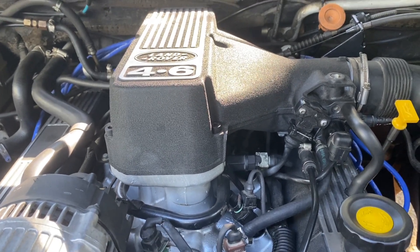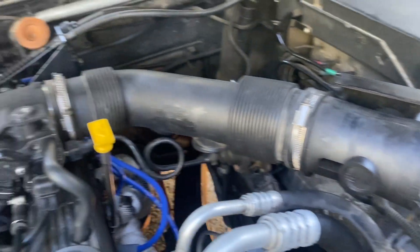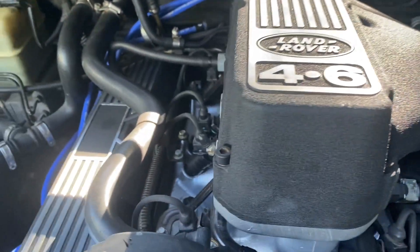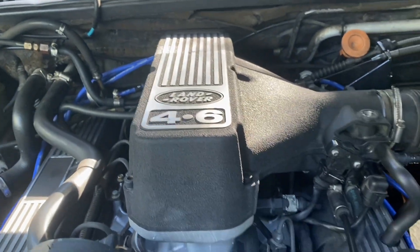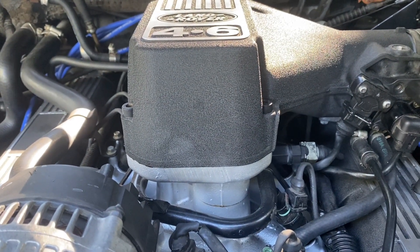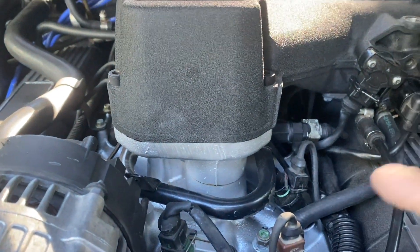I'm not going to just sit here and record every last detail. Basically it starts here — I've got to take the MAF sensor off, the hose off, disconnect those. Then I'm going to take the plenum off, which is six Allen screws. So that's the plenum there. I'm going to tap that off, lift it off, get a bit of a tap with a rubber mallet. It's just perma-sealed, nothing major. And this is the fuel rail here, and obviously injectors down there. So I'll get all that off.